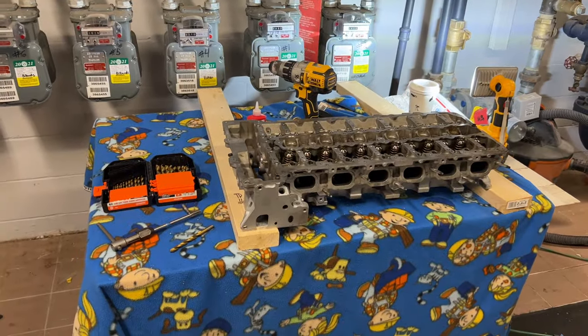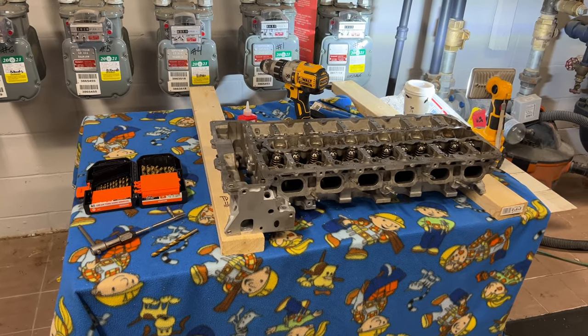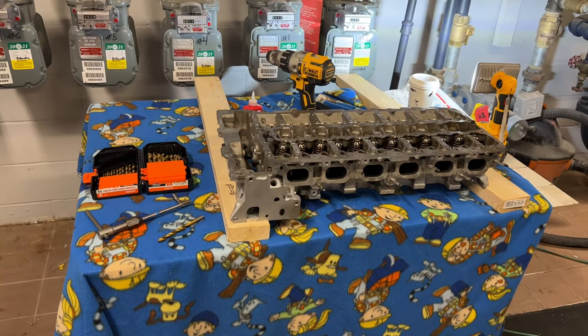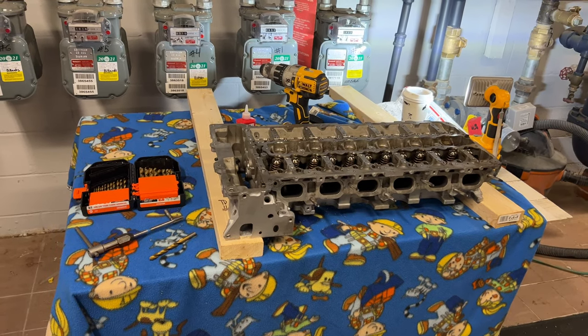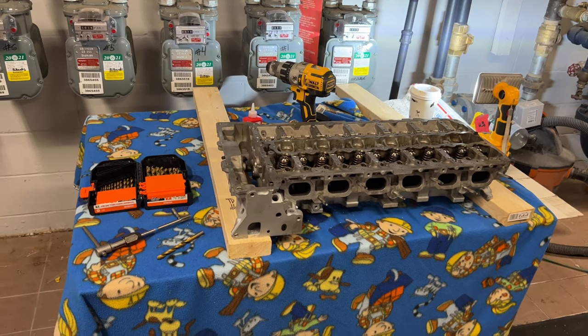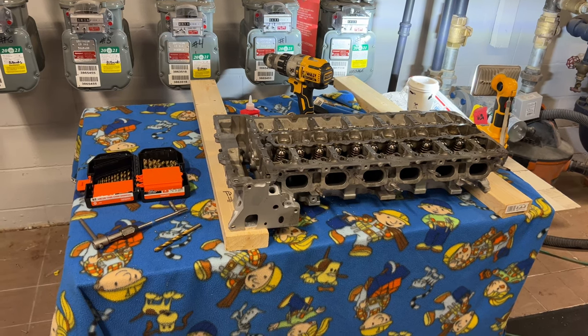Rather than with MaxxECU, it's literally a race ECU, so whatever you tell it, it's going to do. It's also CAN bus, so I mean, you can't really go wrong with it. Everything in the car still works like a stock car. You have your radio that works, gauges work, traction control works. If the car's keyless entry, it still works. Like, everything still works. The EKP works.